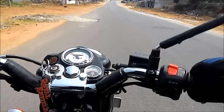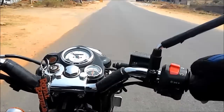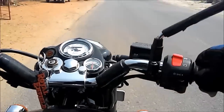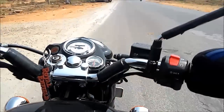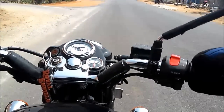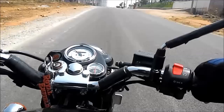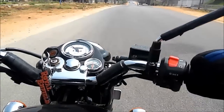But in a wet condition, the front brakes have really good bite but the feel at the lever is lacking. You won't know how much force the brake pads are putting on the disc, so you'll end up pressing a little more, the front wheel will lock up very quickly, your tire skids out of control, your bike skids out of control, and you end up falling by the side of the road.